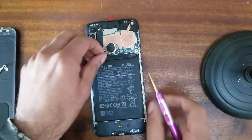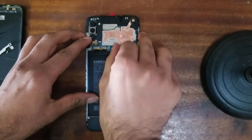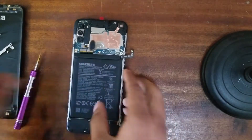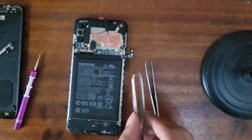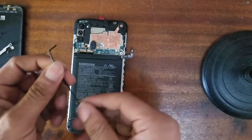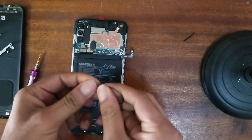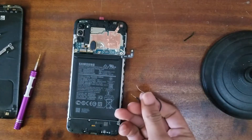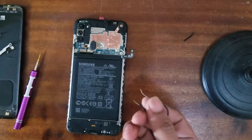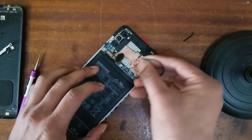It's done — it's a two-minute job to open it. Now take off your battery strip. Next is the test point. How we can use the test point — with tweezers. If you don't have tweezers, don't worry. You can use a wire. Clean the wire and touch the test point like that. A thin wire is better. If you have tweezers that are a little bit thick, it's harder — a thin wire is better.